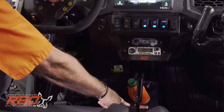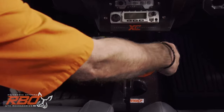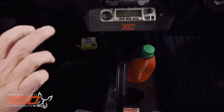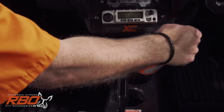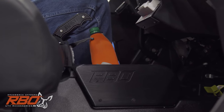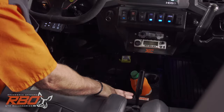We did a 3D printed drink holder. What we did is we mounted these at an angle so we raised the drinks — normally the drinks sit about four or five inches lower, and again when you're belted in you can't reach them. We angled this one this way for the passenger seat and this way for the driver's seat, and then we used spray foam in the bottom of the drink holder. We're quite proud of that — it keeps your drinks cooler.